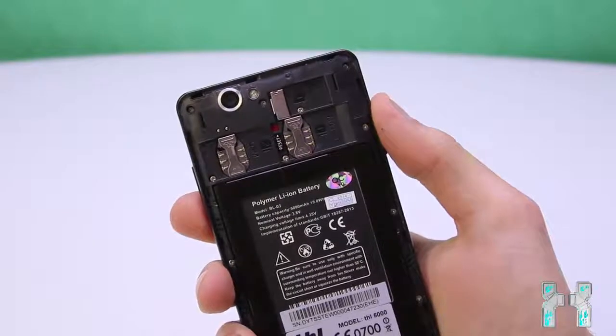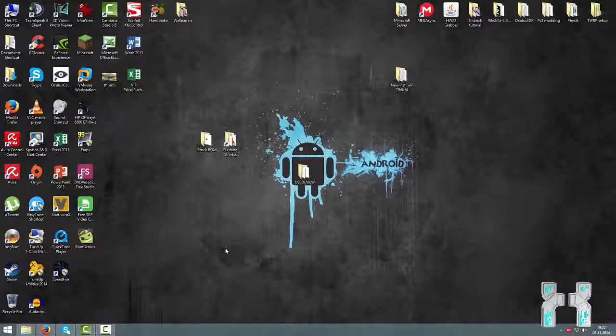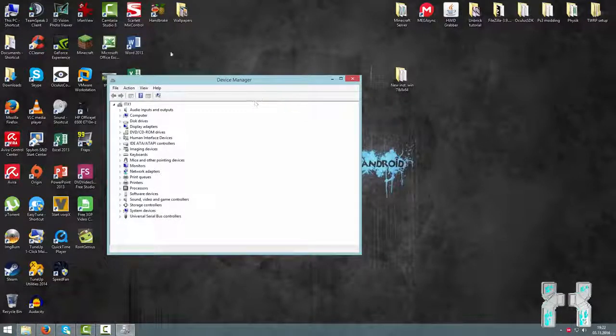Now on the computer, make sure you have the USB driver folder accessible on your desktop. To get to the Device Manager, go to the Control Panel — on Windows 8 you can press Windows+R and type 'control panel'. Then go to System and then Device Manager. Now try to connect your smartphone without battery, holding volume down or any of the volume buttons, maybe also with the power button, to see if it gets connected. I also want to show you what it looks like if you have a disconnecting and reconnecting preloader.